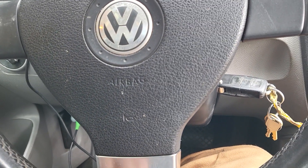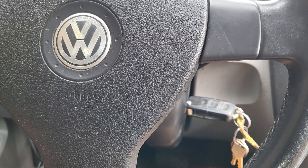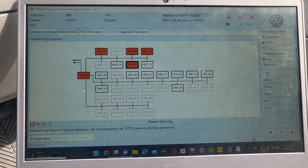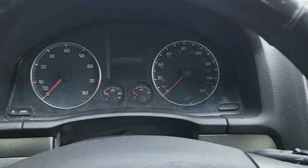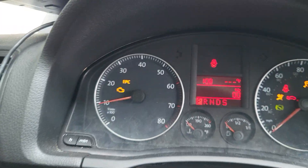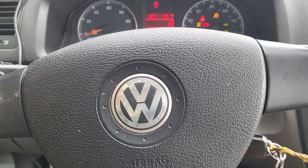When I came back, I found there was no key programmed at all. Maybe they tried to program it, deleted the key, and were not able to write it back. So I used the Volkswagen Audi software. I synchronized the engine control module but it still said no. Then I synchronized the key — it asked how many keys I wanted. The security light was blinking. I said one, and after programming it, everything was okay.